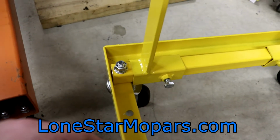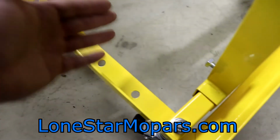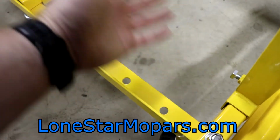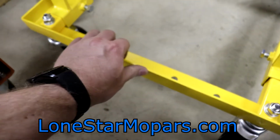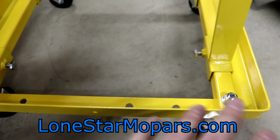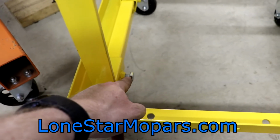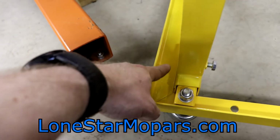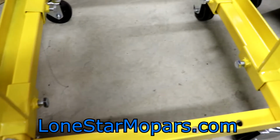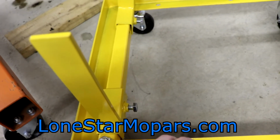You can kind of break those down. They recommended you have them on the inside. Their picture showed them both facing away, so where I have this one on the inside, they would have this flipped, even though that doesn't match with what they said. But my logic was, with this having to be outboard all the way, in the event that we wanted to really bear down on this with a socket, we cannot do that with the framework of the angle iron right there. So I elected to have them both face in, which is what we're going to do. That way, wrench, socket, whatever I want to use, we can make happen.